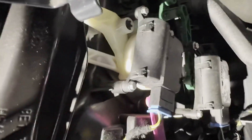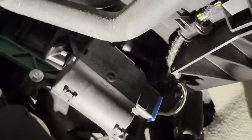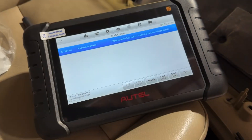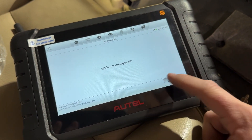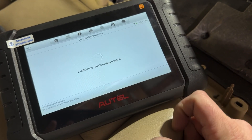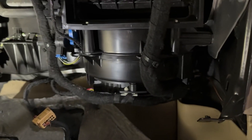That's working. I've now done it with this one and also the central flap actuator — you can tell that one's also not an Audi original part, unlike the others. That's how you replace it — just put the glove box back in reverse order. Here's the code I was getting for the recirc flap motor — I'm going to erase it now that I've replaced it and run it a couple times. You can see it's clear.